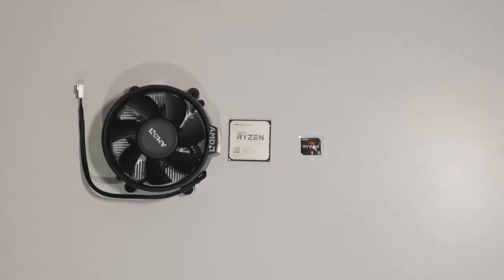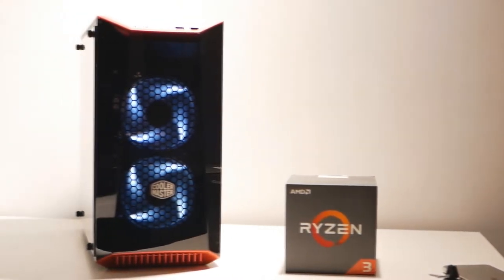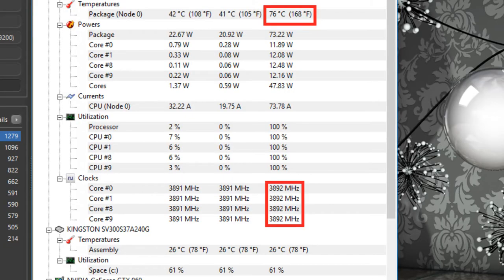Up next is that Ryzen CPU I mentioned. It's a Ryzen 3 1200, and what I'm loving about AMD at the moment is that they have so much versatility. For £48, I got this 4-core, 4-thread, overclockable processor. If you wanted to spend, say, £60 more, you can get a 6-core, 12-thread beast Ryzen 5 CPU. So plenty of upgradability in the future to more powerful CPUs. My Ryzen 3 1200, I did manage to overclock it to 3.9 GHz, about 1.35 volts, and kept things stable. Increasing the voltage was not enough for me to get 4 GHz. I was happy to get as close to the magic number 4 as I did.